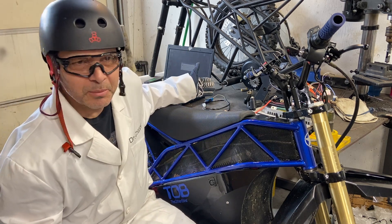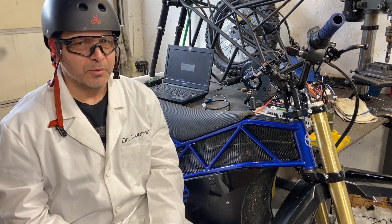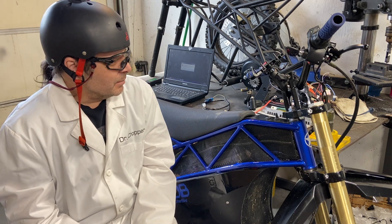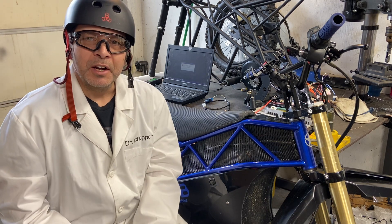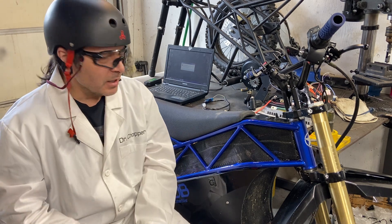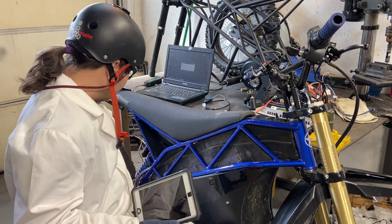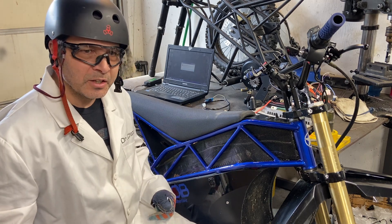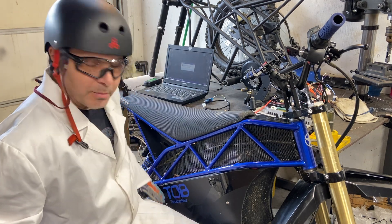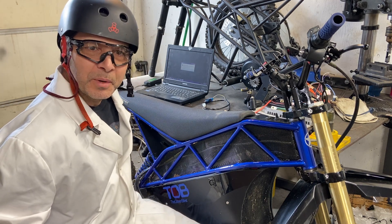Riding the bike and building the frames is just awesome, but programming your controller — that's the most important part if you want good throttle response. I used to be a street rider, but I fell in love with riding in the woods recently. Now I have a mid-drive bike with a chain; it's perfectly balanced. Hub motors are great — I love my hub motor — but when you talk about unsprung weight, that means having weight on the swing arm without a spring. If it's sprung weight, the motor is in the middle, so there's less weight on your suspension and it doesn't bang around too much.